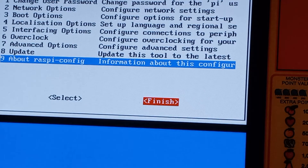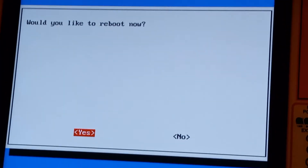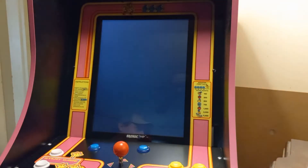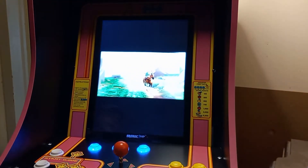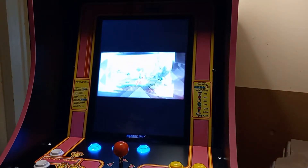Resolution is set to 17, so go down to Select, go to the bottom, hit right arrow for Select, right arrow again for Finish. Hit Finish and it asks if you want to reboot — hit Yes and hit Enter. The machine is gonna reboot. The menu should be good to go as far as that word 'Launch' being clearly visible. Every time you do these settings you have to reboot, otherwise the settings don't take effect.